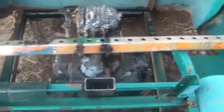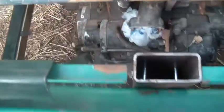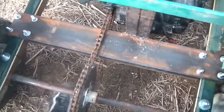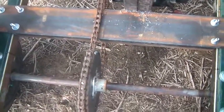You really want to work at that. You've got to make sure your sprocket is parallel, which means it can't be cattywampus back and forth, and you can't have your motor cattywampus either. You've got to make sure everything's nice and parallel. In my case I can still slide my sprocket back and forth, so I'm all good.